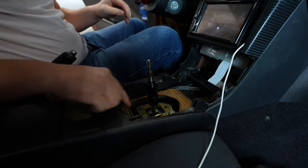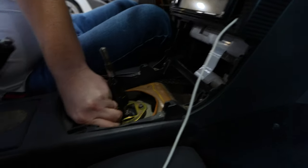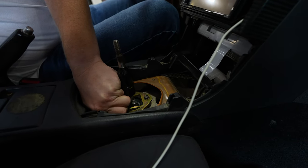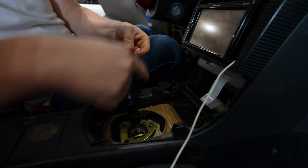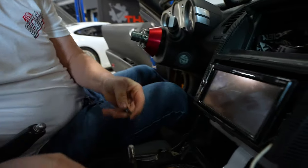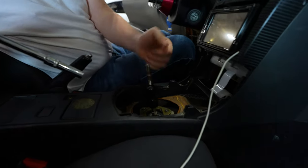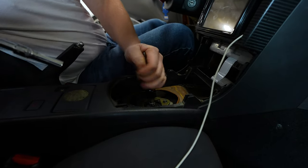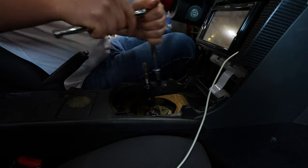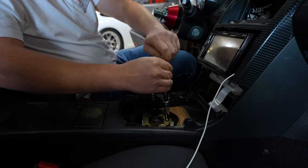And you had a bolt backing out there, Dave. All right, so 10 mils here. Apparently you don't even need tools to take apart Dave's car. These are different from the 4 10 mils at the top. You can see this little step piece on the bolt. So make sure you keep everything separate, keep it organized. And now this shifter is tensioned. This plate helps keep it down. Now for like your reverse lockout. So as you loosen this, it will pop up. Be aware. And you can see it raising up as I take it off. There we go.